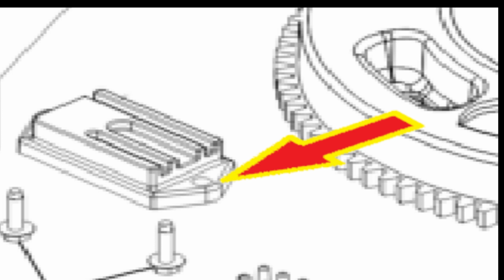I removed the rectifier, and I found that white corrosion that you find on aluminum. I sanded the metal plate down. I sanded the contact points of the rectifier, reinstalled it, recharged the battery, fired it up, and it's been running since June without any complaints.